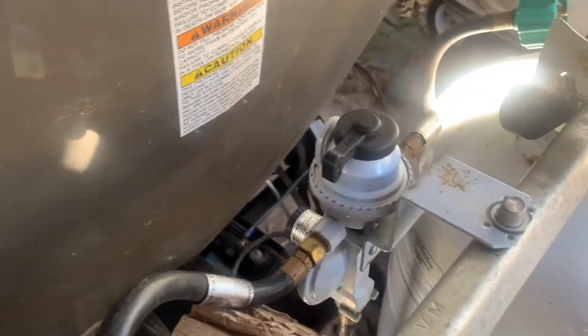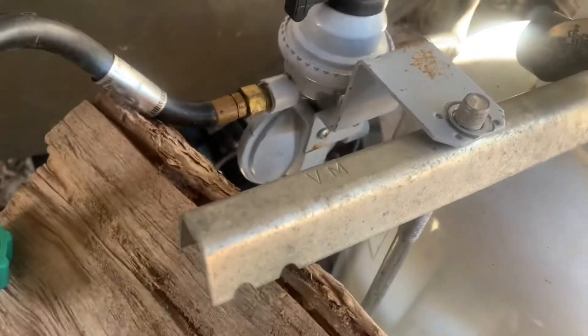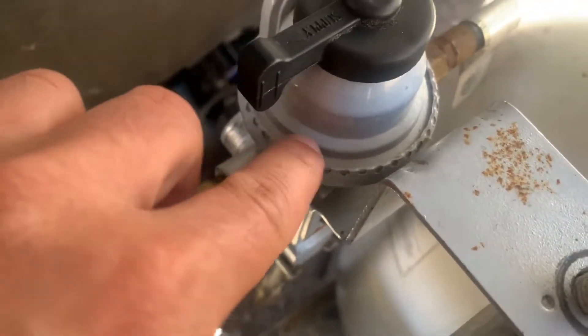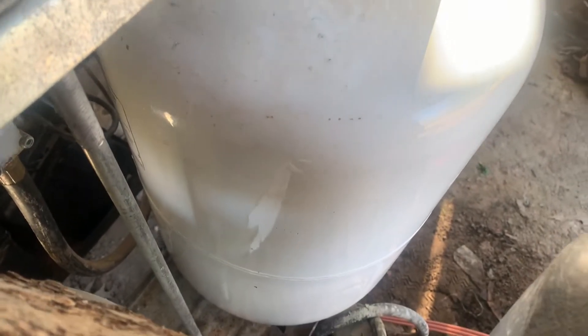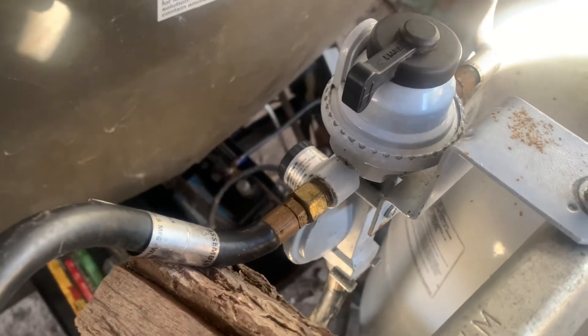Here's the latest issue I've had. This is my camper propane system. That is the regulator right there, and whenever I connect it to the propane, air is leaking out along this seam here. I sprayed some soap in there, and that's how I figured out where most of the propane was coming from. This is a double-sized propane tank. I had just connected a full one, and within two days it was empty, and I figured out that I must have had some kind of propane leak.